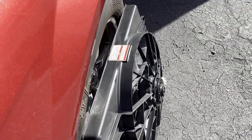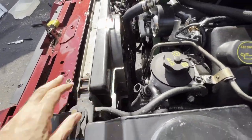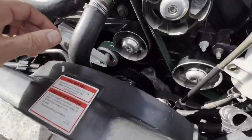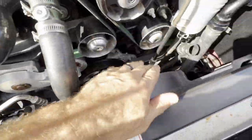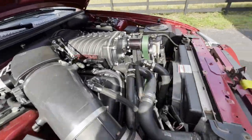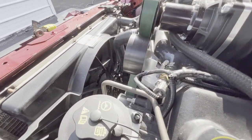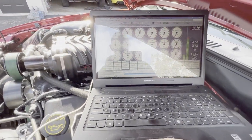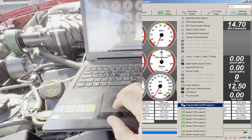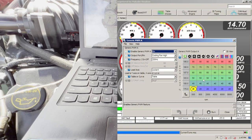Some soap water and a lot of elbow grease — it doesn't look so junkyard anymore, it looks a little nicer going into the car. Fan is nice and solid, brackets are working out great, we've got plenty of clearance down here between everything, the ABS unit clears nicely, no interference. Since this car has an MS3 we can very easily run this fan through some paces and tests to make sure it's working like we expect before we finish closing everything up.